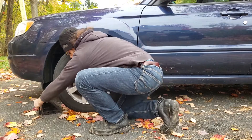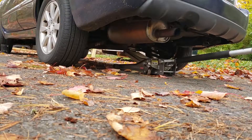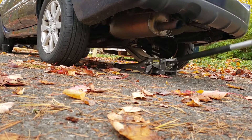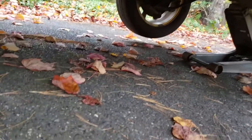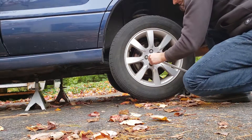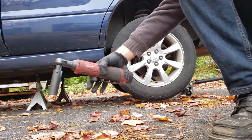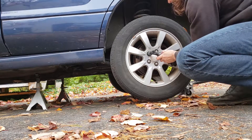First, we're gonna lift the car, and of course, safety first. Chock the wheels. The rear diff is a good lift point if you want to get both rear wheels off at the same time. Use jack stands, either on the pinch welds or on the frame rails. Here's a pro tip: break the lug nuts loose before you lift the car. Here's another pro tip: an impact gun or ratcheting wrench can save you a shitload of time. 17mm lugs.